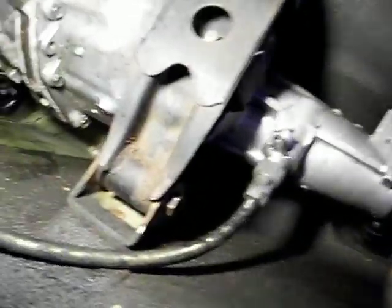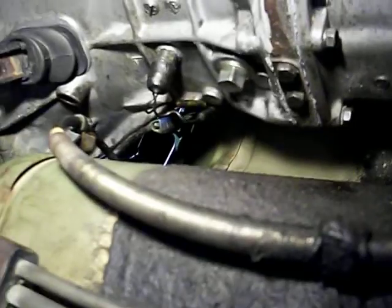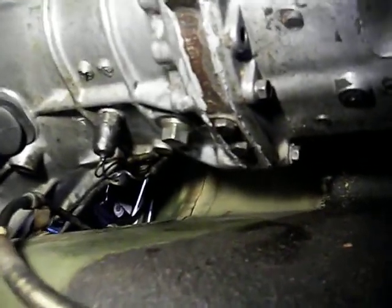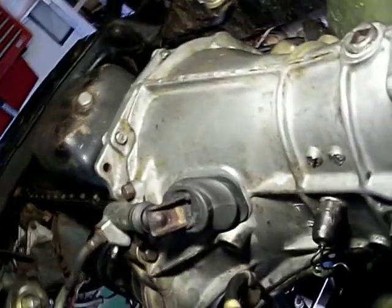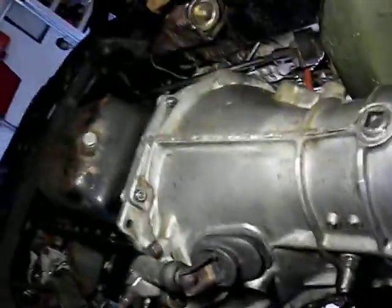It's looking good — I'm pretty excited. I got MT-90 transmission fluid in there. That's a GL-4, synchro-safe, yellow metal synchro-safe fluid. It doesn't have a lot of sulfur content — you don't want to use hypoid-type gear oil with brass synchros from what I understand. Nice new rubber gator on the shift boot — that looks good. I've already shifted the shifter and it looks great. More to come later, but we're almost there.